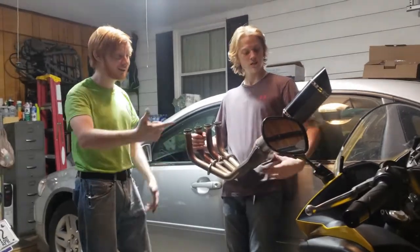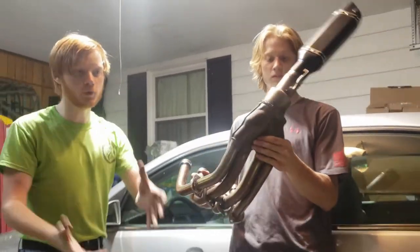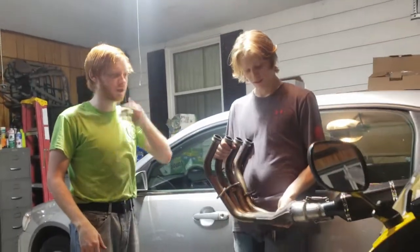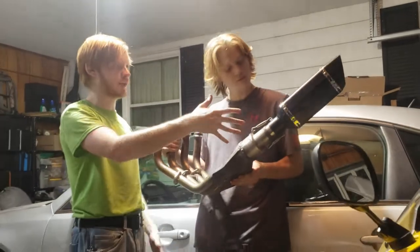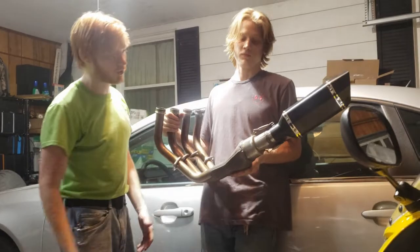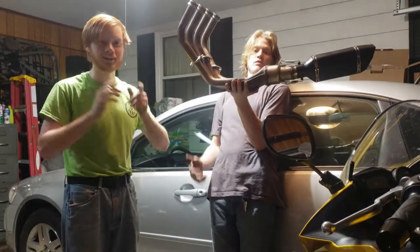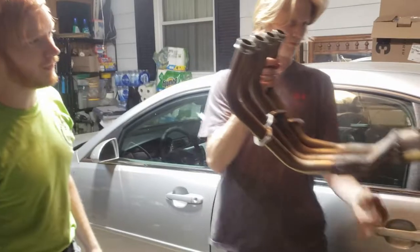As you can see, we got it put together. It's a lot of tacking and moving and configuring to where you want it to be. Our welds are junk, they're boogers, they're, as our buddy Joseph said, popcorn. But they'll hold, they'll seal, and as you can see, we got both the springs on. It's probably still hot. So all we gotta do now is put the header back on, put the bracket on, and get your $60 FZ6R exhaust. So that's a pretty clean exhaust, I think. Yeah.